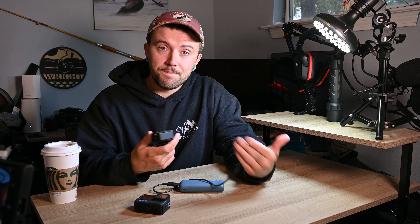But here's the problem with this. You've got a wide open battery door. All of your electronics and internals of the camera are now exposed to the elements. These are waterproof with the door closed and locked. With the door open, this camera is no longer waterproof and you'll kill it instantly if you get water inside there. So this is a problem — so what do we do about this?